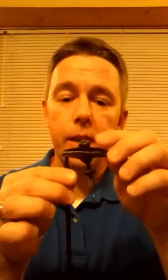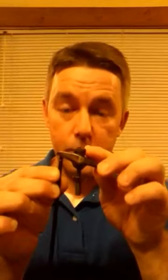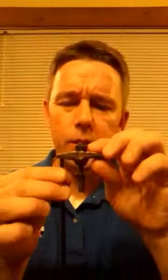But when you cut these heads, I've actually seen people's engines at the track that the rockers are in it like that on zero lift. And when that thing goes down, one thing it'll do is it'll bottom the rocker out and bend and break the stud. But with rollers, it can actually roll off the valve. And if it rolls off the valve, then you've got a lot of broken stuff there. But that's just kind of one thing I like to tell people when they go to cutting on these heads.